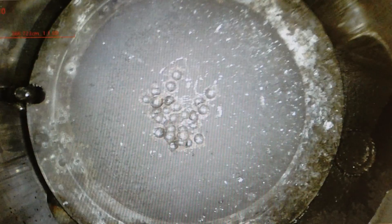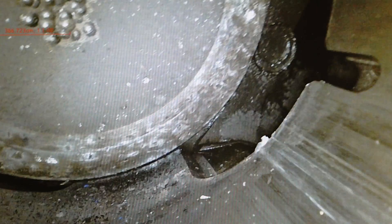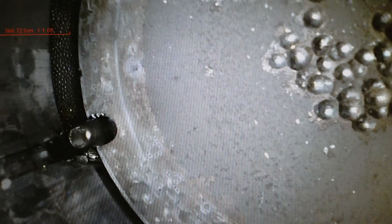Door number one — oh yeah. That, my friends, looks like a needle bearing. So that is telling me that that piston is not going to be removed easily. A lot of scoring going on. You can see where it just bounced right in the center and eventually caught on one of the ports and dug straight in. That would be why we can't turn over.